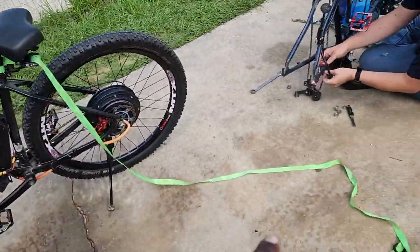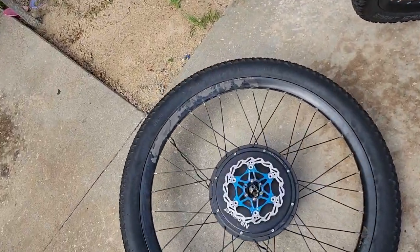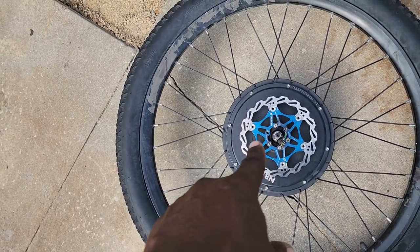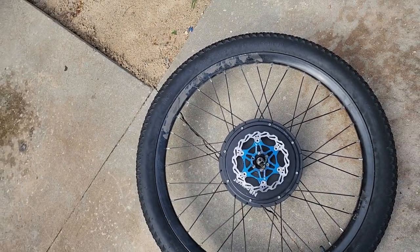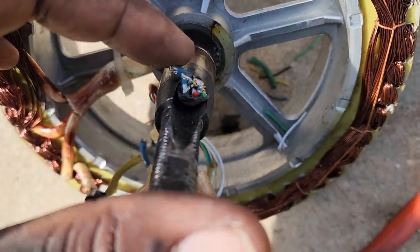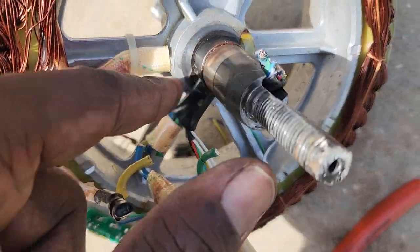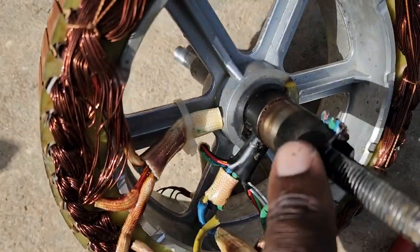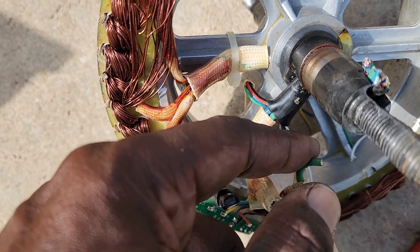We pulled it home with my son's e-bike. What we're going to do is open this hub motor side cover up and see what we can do to get those phase wires changed out. If we can't, we may have to open the other side too. You can see it's been damaged all the way to the shaft, to the axle. We're going to take this out, splice the motor cable — it'll be a little shorter — snake it through the axle, and solder right here with some heat shrink.